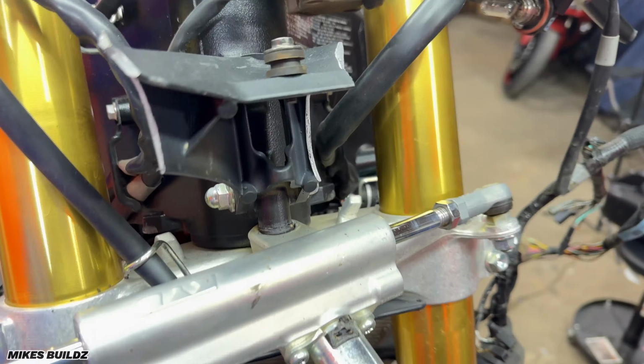And I've also connected one of the hoses like this, and I've hooked it up to the air gun. My goal is to pressurize this and confirm that this is in fact the only leak on this rad before I attempt to fix it. Obviously, I know there are pressure testing kits out there for sale, but this is a quick DIY that I just came up with on the spot before I went ahead with the process of repairing this rad.